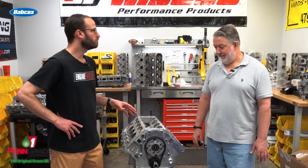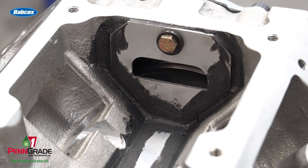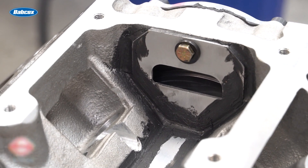It's got a dry sump system — I think it's six stages. It has either three or four scavenge stages on the bottom, one on top, and then a pressure stage. He may also have an air-oil separator that centrifuges the oil from the air, so it might actually be a seven-stage system. It's really more of a true race engine. Even if the scavenge up top were to fail, the oil would go around the belt drive and it can pull vacuum on the bottom end because everything else is sealed.